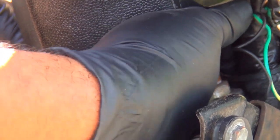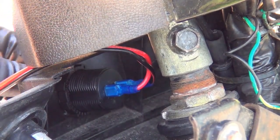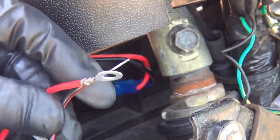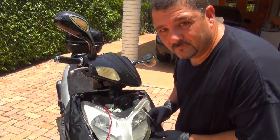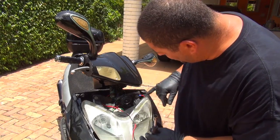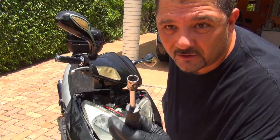After you make sure it's nice and tight, you have cables coming out — one red and one black. One comes with the fuse, which is fantastic. The million dollar question is: where are you going to connect these two wires? Let's start from the black one. I will connect the black one right here where the ground of your headlight is. You just unscrew the bolt — that is a 10-millimeter, you need a 10-millimeter socket. Unscrew it so you can have a little more room, and pull the light a little bit, but not too much or you'll break it.